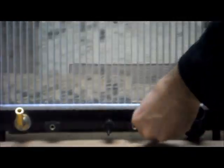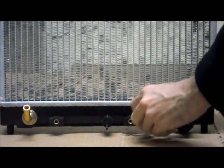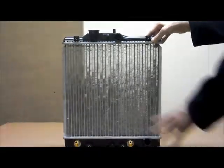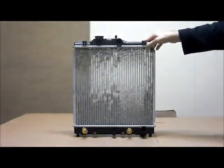The fittings can easily come off if you have a manual transmission — they are basically removed and it just doesn't get used. It's completely safe and not a problem. So this radiator is suitable for both manual and automatic transmissions.